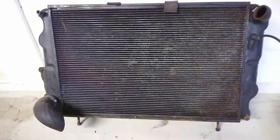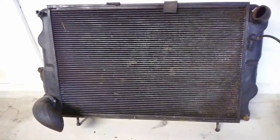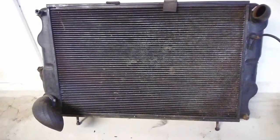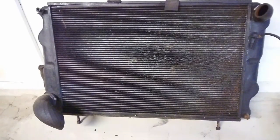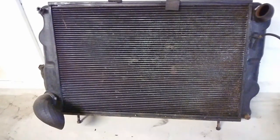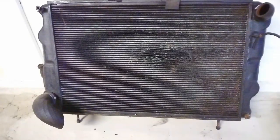Now the radiator is out, it was just held in place with those 2 bolts there at the bottom. You can just lift it out. Looks to be in excellent condition, can't see any leaks from it. Looks to be fairly new, it's definitely not original to the car, it must have been replaced at some point. So I'm just going to be flushing it out and then it can go back in the car again,